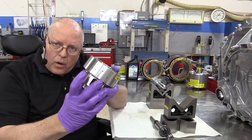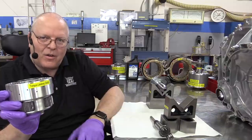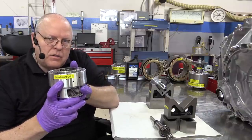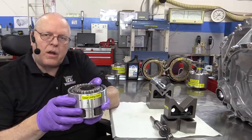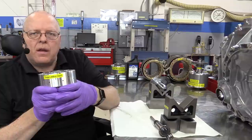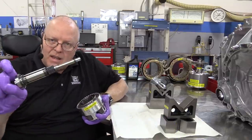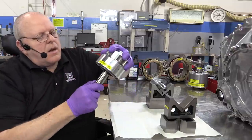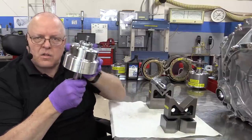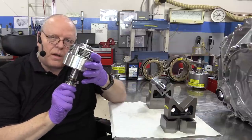I've installed the snap ring down as far as I can get without compressing anything, and then I'll use a clutch return spring compression tool in the arbor press to press it down far enough to finish seating the snap ring. Now I've got the planet carrier with the sprag and the torque-limiting six-fiber-disc clutch pack all as one big assembly. The purpose of the torque-limiting clutch is to limit the maximum amount of torque delivered from the engine to the transmission, or from the transmission back to the engine.